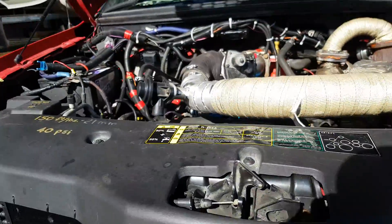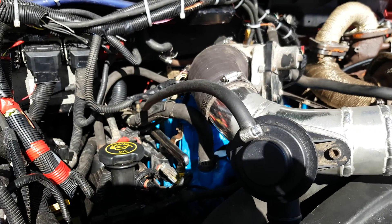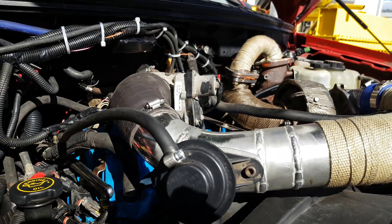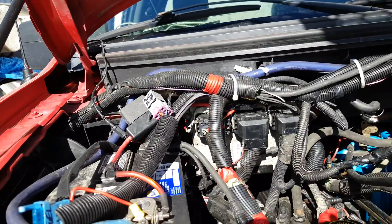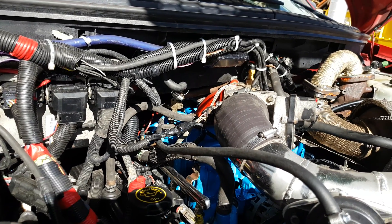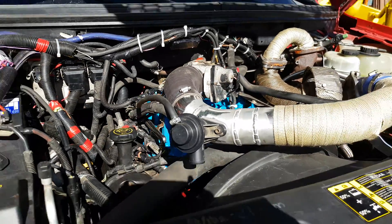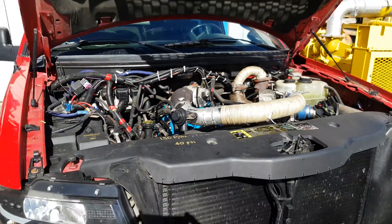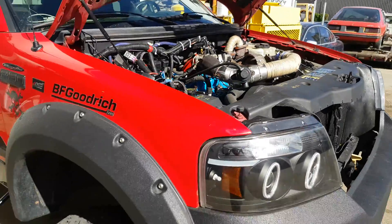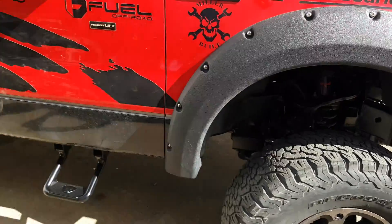So that's basically it. You'll have to do a little bit of custom work for your intake, but that's a possibility. I went ahead and turbocharged this one and it's running on a MegaSquirt standalone — a MicroSquirt in the corner there — and it makes six pounds of boost. It runs on regular gas and it's freaking awesome. So that's a 5.4 three-valve to two-valve swap, and it does not make less power.